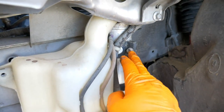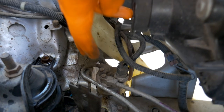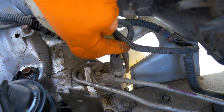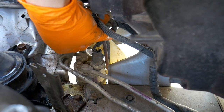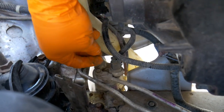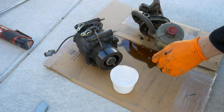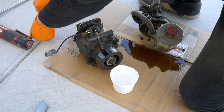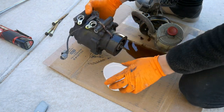Let's finish off getting the last part removed. Take off this little 10mm bolt holding the receiver dryer to the bracket. On top you'll have two 10mm bolts for the lines that feed the receiver dryer. We're going to reuse the sensor which plugs into the receiver dryer — there's a clip here, you just squeeze and pull it out. Then we can get the receiver dryer pulled out. Now I'm going to dump some of the oil from the compressor into a clean cup to see what we're looking at. Hopefully there are no metal fragments in there.